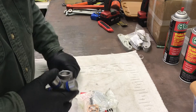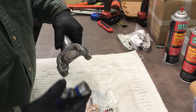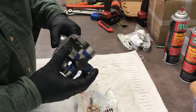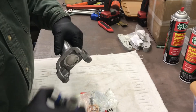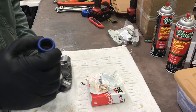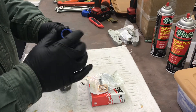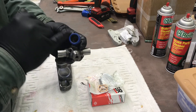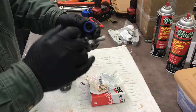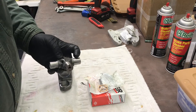Grease fit and orientation — I like to put it just like that, same with the back. I know it's going to be protected up in here. Drive shafts sometimes aren't cut the same, but I know it's going to clear here. You're going to remove all four caps and pack the cavity with grease. Use your small finger and push it right in there — they don't give you enough at the factory. You want them pretty secure, so use the same grease you're going to grease it with afterwards.